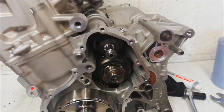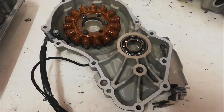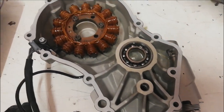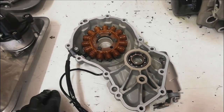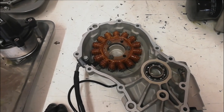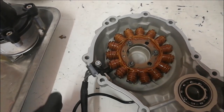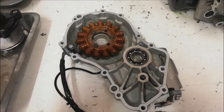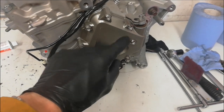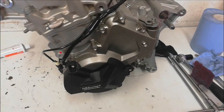I've cleaned up all the face around here and run an oilstone across it to make sure it's perfectly flat. I've done the same with the outer cover — removed all the old sealant, removed any old oil and bits, giving it a really good clean out so it's a perfect fit. BMW, other than on the clutch, don't use gaskets, so it's crankcase sealant, and I'll be putting a thin smear all the way around the cover. We've abandoned the single-use BMW bolts and put in nice shiny stainless steel hex head ones, so we can use them as many times as we want. That's this side done.